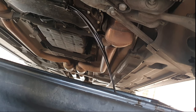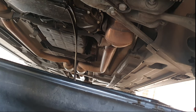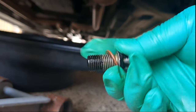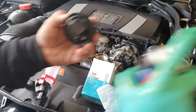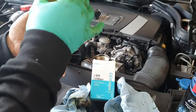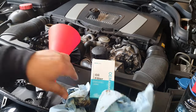Clean up any spilled oil right away before it stains. As we wait for every last drop to come out, let's reinstall our oil filter. Clean off the sump plug area nice and clean — you can hear the oil dripping, which is good. Here is our washer — you can replace it too; I've only used this once so it should be fine, but they do recommend replacing it. Let's also clean the oil filler cap so we can tell the new clean oil apart from the old. Re-lube the filter seal — you can never have enough — and reinstall the oil filter.